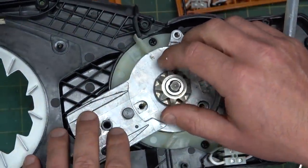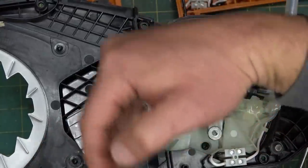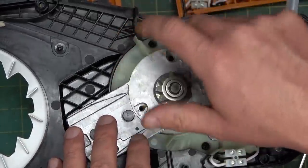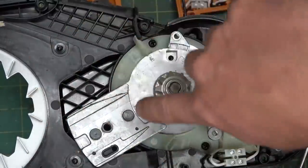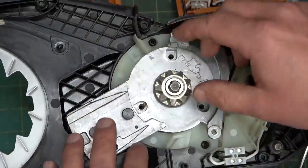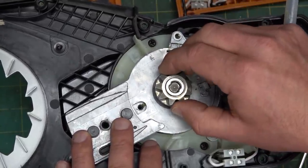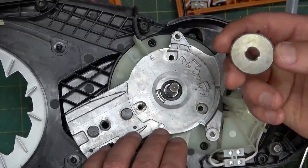You do have a situation in chain of cogging, because it's not a round section, right? You have small lengths of square sections. So what happens is the chain speeds up and slows down the whole time it's running as it cogs around, tuck, tuck, tuck, tuck, the sprocket and idler. So every time it cogs around now, you're getting a tuck, tuck, tuck through here. I might not be able to catch it on the high speed.